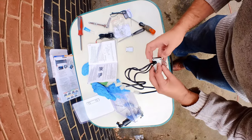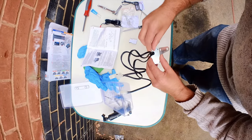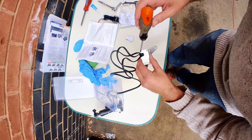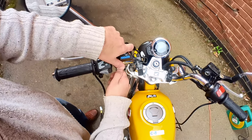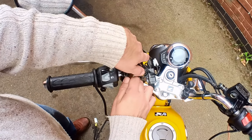Next is the controller. It comes with a universal mount that goes on your original switch gear. Get the controller out, use the four little screws to attach the controller to the bracket, then attach the bracket onto your switch gear. Take out the two bolts — there is a spacer that you put in — and hopefully it will all go on nice and smoothly. It's very universal and pretty much standard size so it should fit most bikes. If it doesn't, they do provide a sticky pad, but I generally recommend using the universal mount.